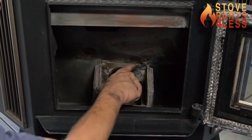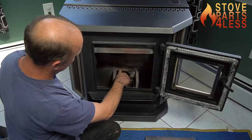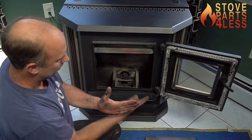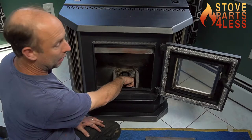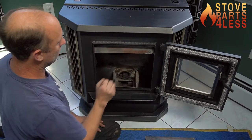When I take this out, I'll show you — this edge right here, if this edge of the burn pot is not flat and it's bowed out, when it's up against the back of the stove there's a gap. The air from there is going to take the path of least resistance, go up the back, and come out — and you're not going to ignite.